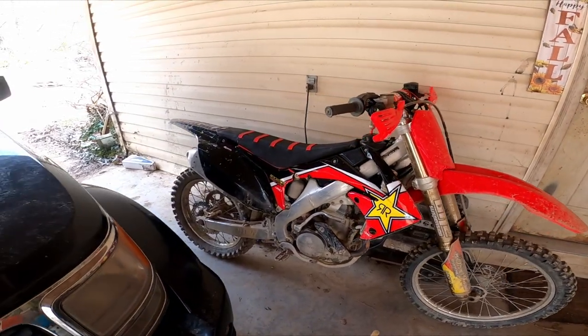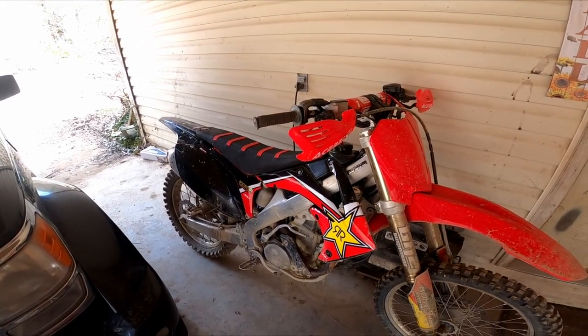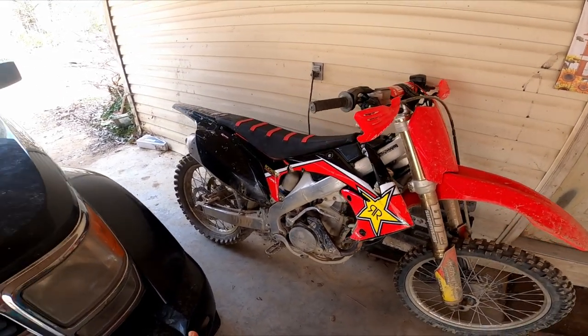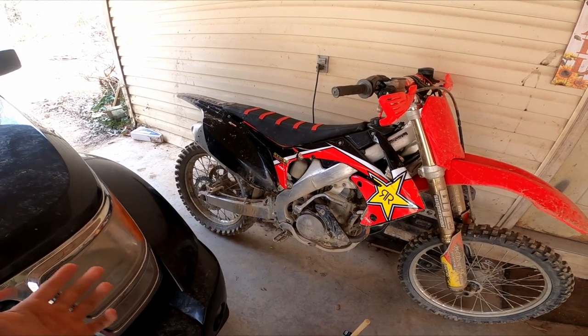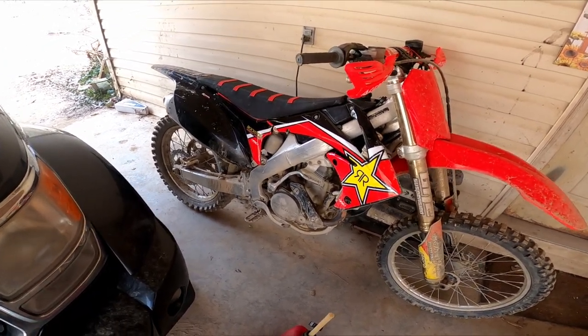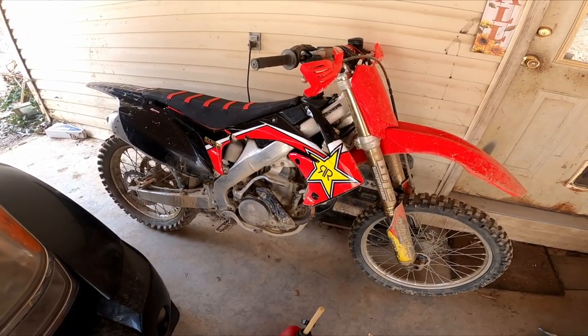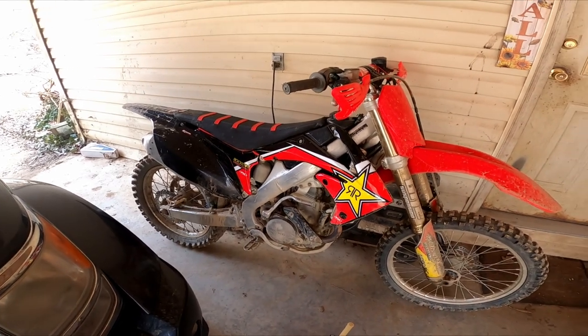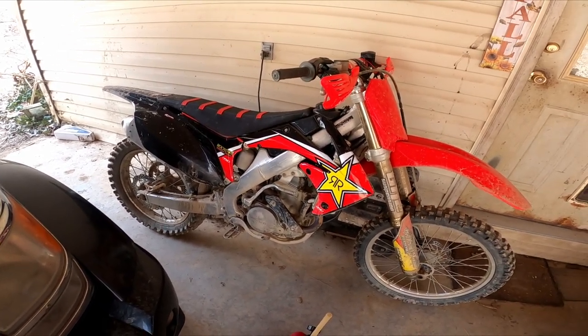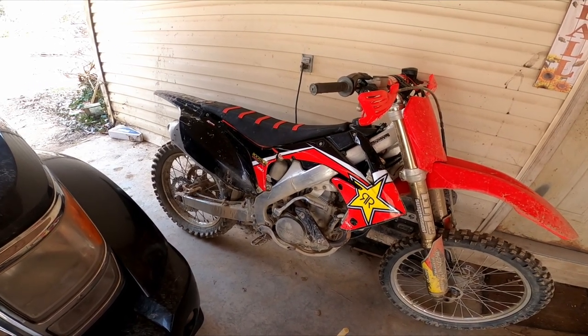It's Weasel here, and today we are starting the video out just a little bit differently. As you can tell, it's really windy outside today. Since the 250R has been sputtering a little bit when I've been riding it, and it only does it when it gets warm, it makes me think it's a valve issue. But if it's not, we'll test it out. We're gonna get some injector cleaner, toss it in here, and run it through the bike, and hope it runs a little better. We'll take her on a ride today, and let's get to it.